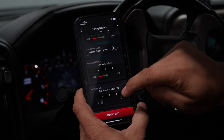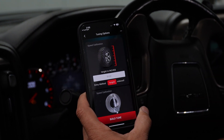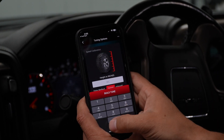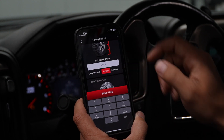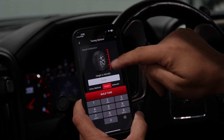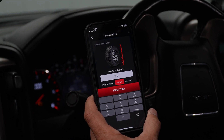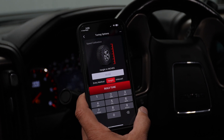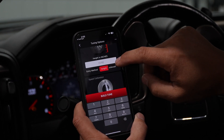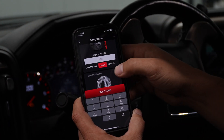Now it's presenting us with our tuning options — features we can fine-tune specific to our truck. We take our preloaded calibration and give the end user the ability to adjust it so it's perfect for your truck. This truck is on a mild lift with slightly larger tires, so we enter the new tire size to correct the speedometer. One thing to note: measure the actual tire height with a tape measure rather than using the size printed on the sidewall, because a 35-inch tire like a 35/12.50/20 actually measures out to about 33.5 inches when mounted, giving you the most accurate speedometer reading.